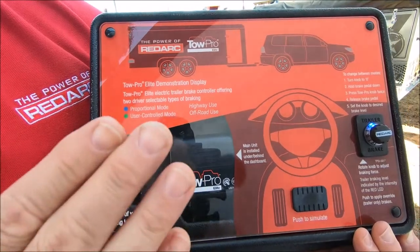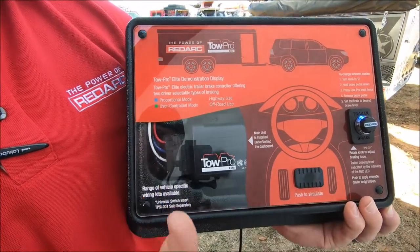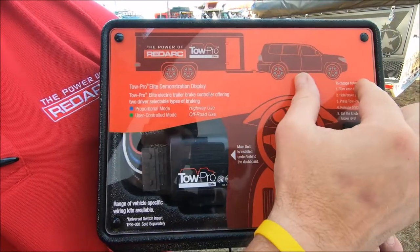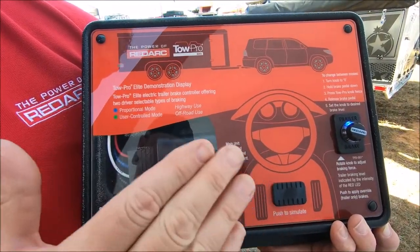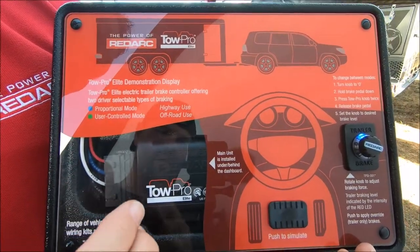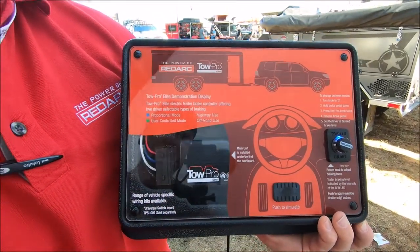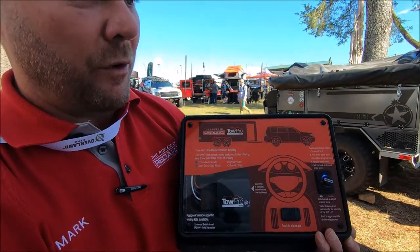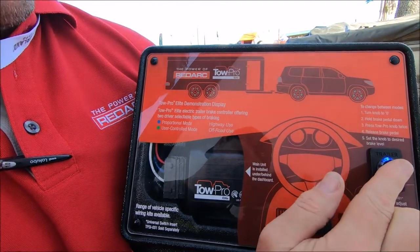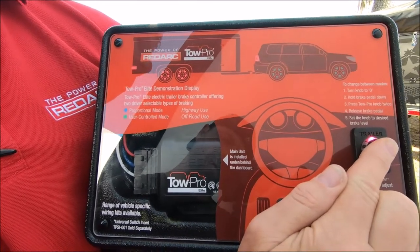Now, if we're travelling down the highway at 65 and the trailer starts to give you sway, the last thing you want to do is place your foot on the brake. What you're supposed to do is accelerate — that stretches the trailer away from your truck. The problem is you're already doing 65, and it can be quite intimidating to be speeding up whilst towing a trailer that's going from side to side. Brake controllers have an override feature. Rather than trying to reach underneath the dashboard to find your slider control, all you do with the Redarc system is simply press that button. In the event of a sway, pressing that button applies the brakes on the trailer independent of the vehicle brakes, bringing the trailer into line behind the vehicle and keeping you in control.